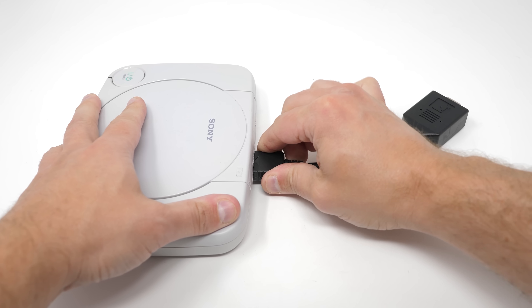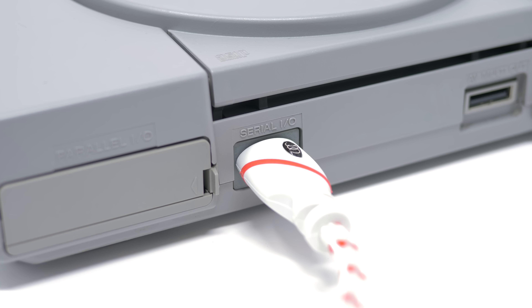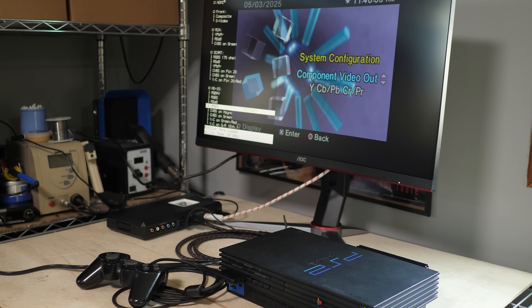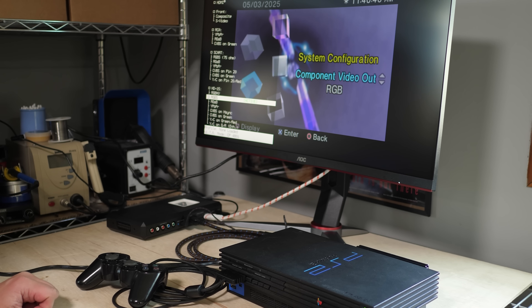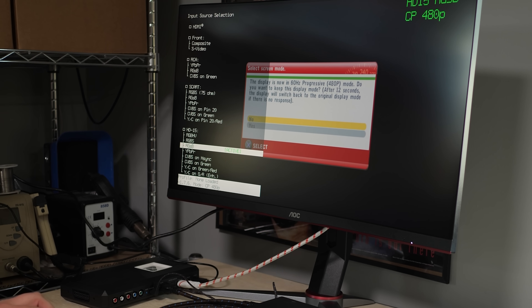Speaking of PlayStation, these should be compatible with all unmodified versions of the PS1. If you have a mod installed that drains a lot of power, like some HDMI mods, you may have issues with any cable. It'll work with PS2s as well, and you could even pass component video through if you need to access the menu to change it to RGB. They might work for YPBPR pass-through over an HD15 connector, but these adapters were designed for RGB, so you might get occasional color issues. Since Sync on Green is an RGB signal, that'll work fine for 480p games over RGB, provided your scaler or display can handle RGSB.